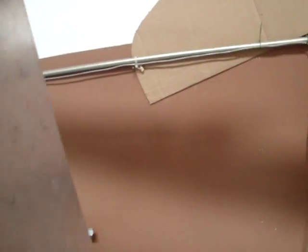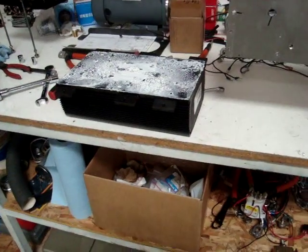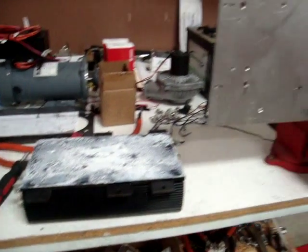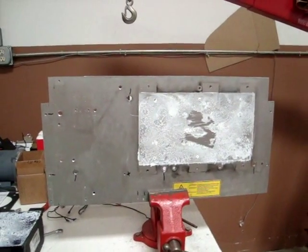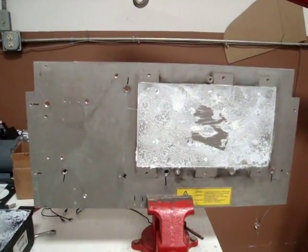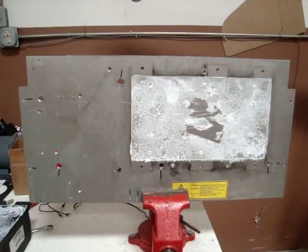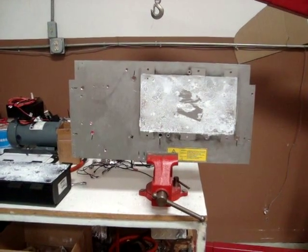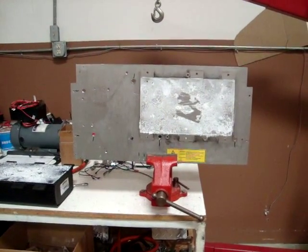This chill plate worked really well, it just was not sufficient enough for that Curtis. And I don't know if you could have one quite sufficient enough. It really needs to be internally liquid cooled, as the Evnetics says. And we'll be installing that hopefully tomorrow. It should be coming in UPS tomorrow, I think. And so we'll have the board ready, and we can design our layout and get that thing back in for the weekend. This is Wednesday afternoon right now.